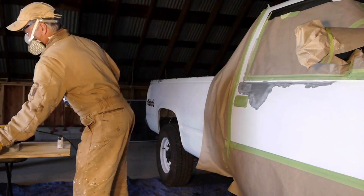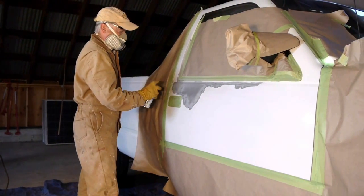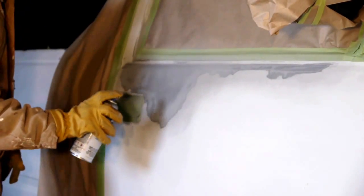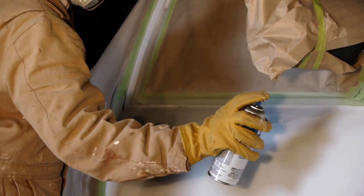The fourth step is to apply primer. It is necessary to apply primer to all unpainted surfaces for the base coat to adhere properly. When you spray your vehicle, the first coat of primer should be misted on the surface. Try to make the surface tacky. Then, apply the primer in light, even layers. The goal is not to have any paint blobs or runs.